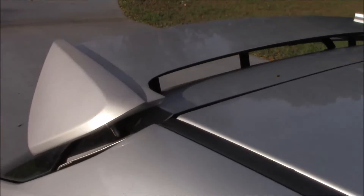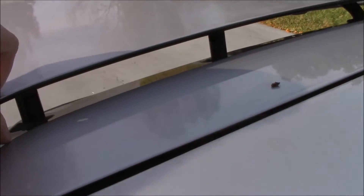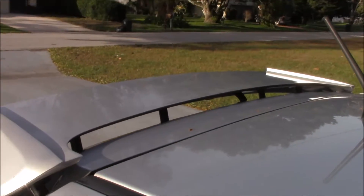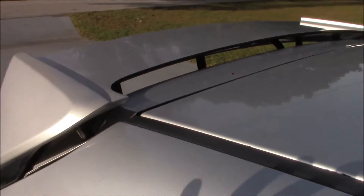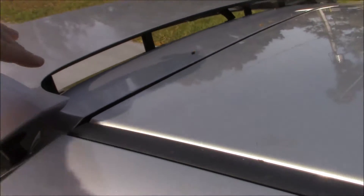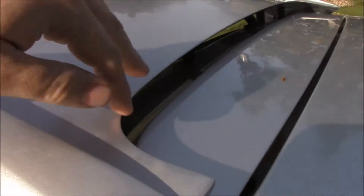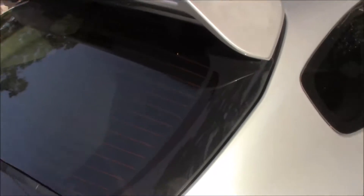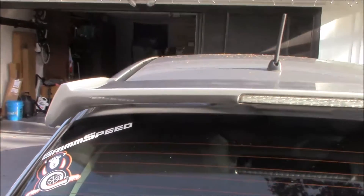As you can see by the final product, there's about an inch gap that the spoiler has been raised up. I have it on the lowest point right now — you can actually raise it more by adding spacers on all of the mounting points. It comes with a bunch of spacers. From the research I've done, if you want to change the pitch angle, you add spacers to the center ones — not the side posts — and that adjusts the pitch angle of the spoiler. Overall the spoiler risers look pretty cool on here.